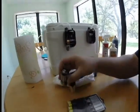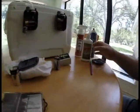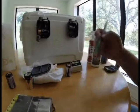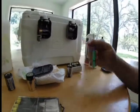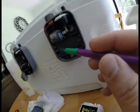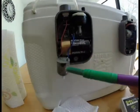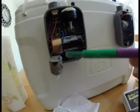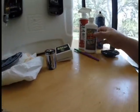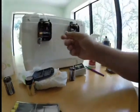What I do when this happens is I take this Crud Cutter — I buy it at Walmart — and I take a little art brush and dip it in the Crud Cutter and brush it on the terminals in here. It kind of kills the rust. I brush it on the motor too; if it gets in the motor it's fine, it won't really hurt it. That kills the rust, so that's the first thing I do.